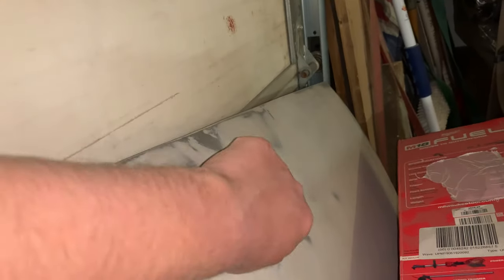So I've got my other hood right here behind my dad's car. The reason I gave up on it is because when I was sanding, you can see the bottom layer came through and the metal got really thin right there. And here you can see basically a box shape — we had to replace that section. There's just a ton of rust. The car also had a bunch of rust, so instead of sanding we had to grind out the rust with a giant 27-grit grinding disc, and it just took forever.